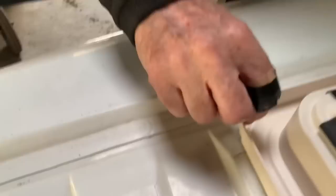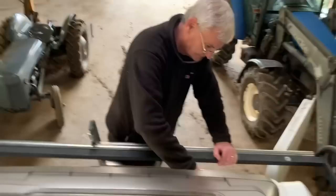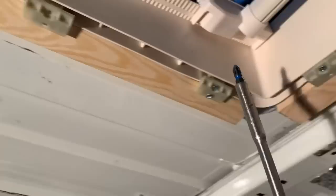You've got to be careful not to block the drain holes — there's one in each corner — so that if it rains, water filling the channel drains out there. We smoothed it off and beaded around the edge. If you have one of these yourself, it's a good idea to lift it up so you can access the edge better to bead it. Underneath, the wooden frame is in and the clips drill into that — we can't drill directly into the van roof. Here is the final roof shot — another stage done!